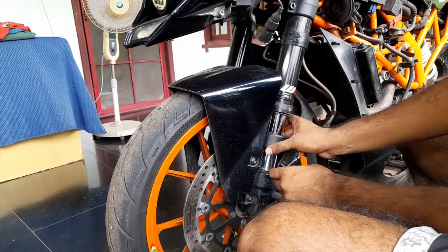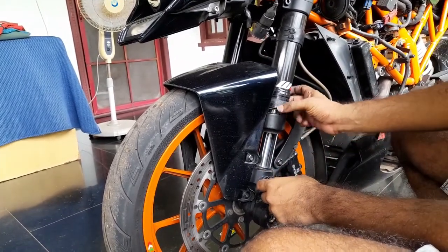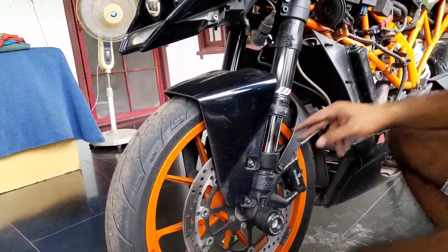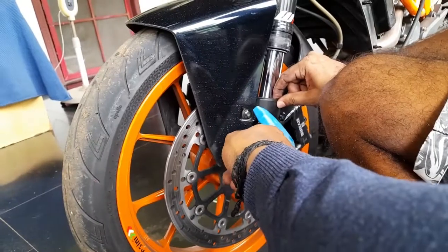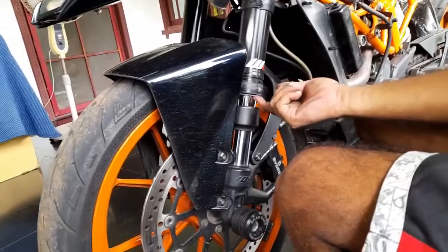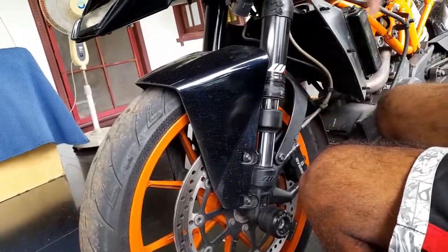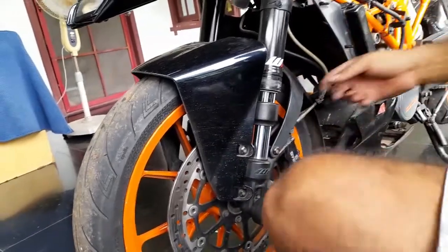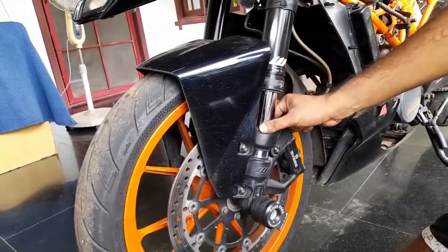This is friction. It's not sliding, you see. We should be able to easily pull it down, but it's still resisting. This is the maximum it comes down from this fork. One reason is because of the friction. You keep continuing like this and after some time the seal will give off. So your friction is the problem — that is what is causing your harshness complaint.